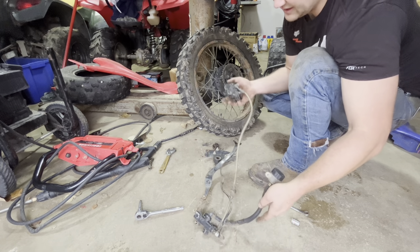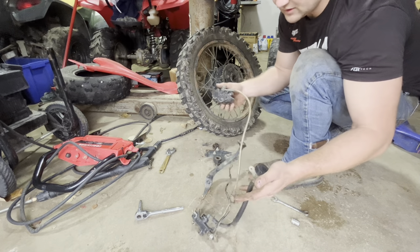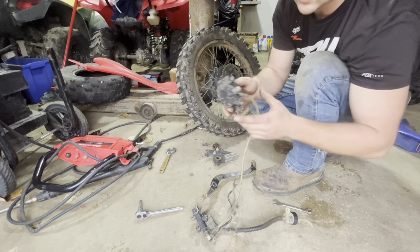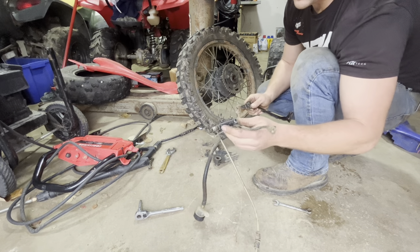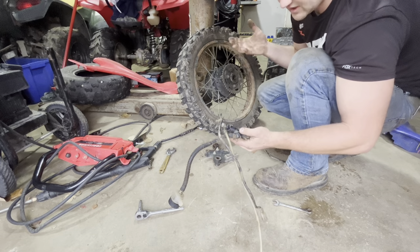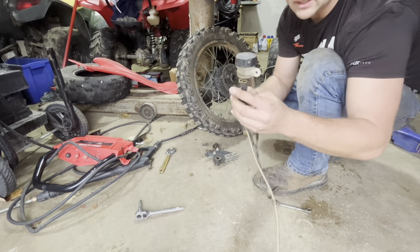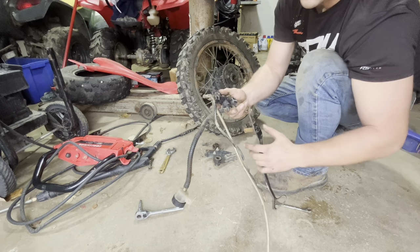The only thing that really goes bad with it is that if you're jumping or riding the bike like you're supposed to, this is what happens to the bolt — it bananas. So that's the rear shock. Now the rear brake system — at 8,000 miles it's a pretty respectable amount of miles, especially for a Chinese bike. What happened with this is basically the bushings, which are rubber stuck in these holes, have worn out and caused this thing to chatter. Another thing is the electronic switch got corroded out from road salt and water — as you guys know, my bike sees a lot of water.